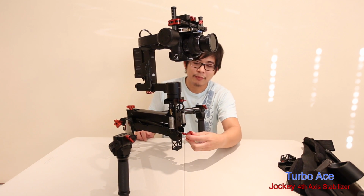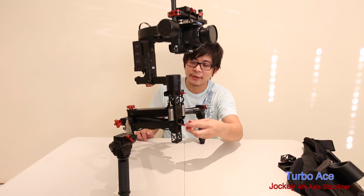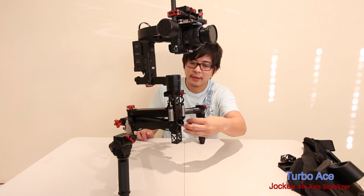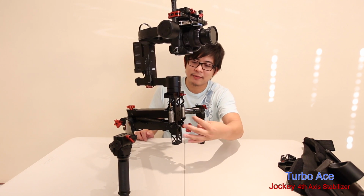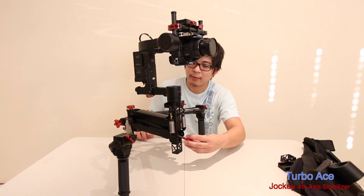So you don't have to worry about moving just a little. You can actually fine tune this adjustment to where you want it to be. So you can see it actually sits a little bit higher now. So let me just back it off about 4 to 5 turns, and just keep on going here. You want this to float right here, right about neutral.